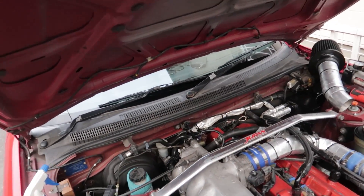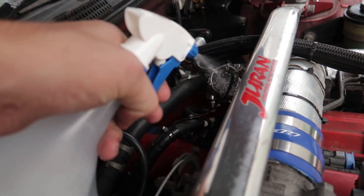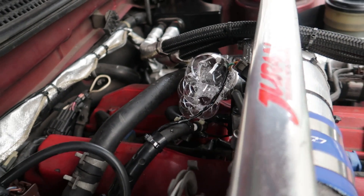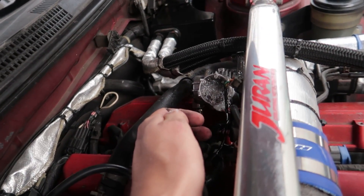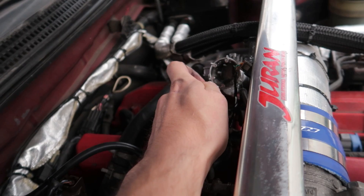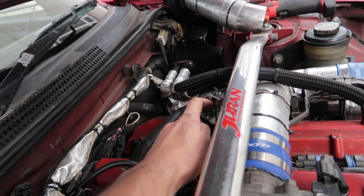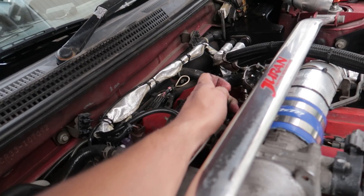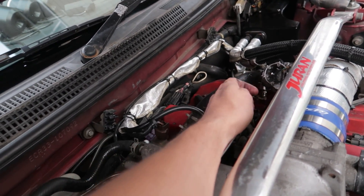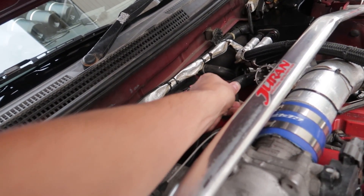The second thing I found: the flange on my blow-off valve isn't leaking at all, but look at all the bubbles coming out of the bulb itself — pretty big vacuum leak there. If I take the vacuum line off and completely plug it, there's no leak anymore. It looks like the diaphragm is shot in this blow-off valve, which is why it's leaking so much through here. So I'm going to completely remove that vacuum line and use a straight connector there instead of the T-piece, and that'll stop that vacuum leak as well.